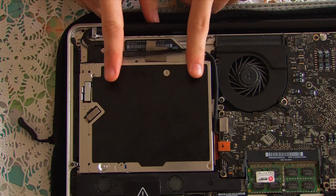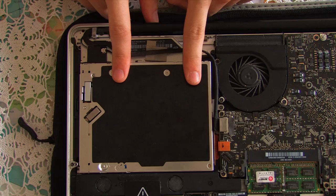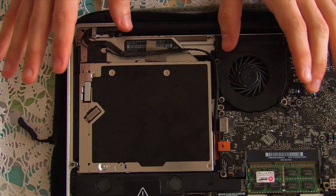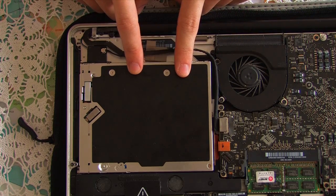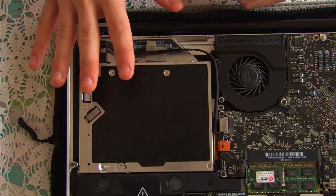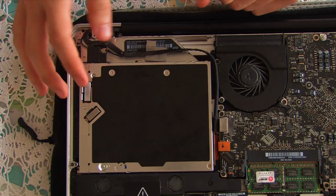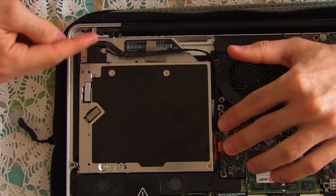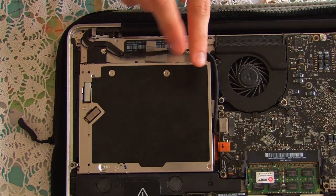For the remainder of this video I'm going to be focusing on the SuperDrive on the inside of the laptop. It's a really good idea to keep numbers in your head with regards to screws. On this particular laptop, an April 2009 MacBook Pro, there are five Phillips screws to take out, one Torx screw to take out, and three plugs.